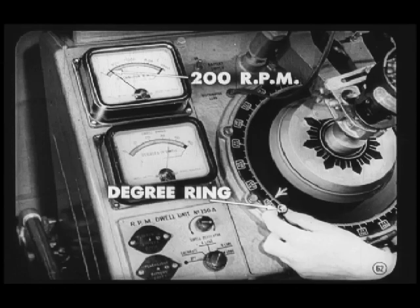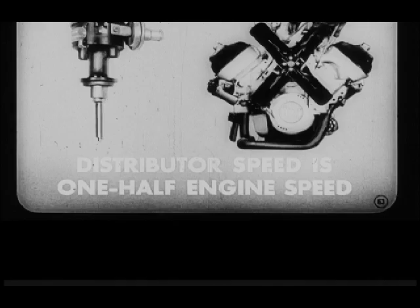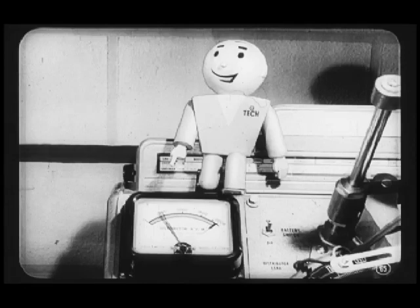Right. Now let's start with the centrifugal advance checks first. We'll run the distributor at 200 RPM and set the zero on the degree ring so it'll line up with one of the flashing arrows. And remember, fellas, that means 200 RPM distributor speed. Distributor speed is one-half engine speed. It's a good point, Tech. Now, let's increase the distributor speed till the arrow flash shows 2 1/2 degrees advance on the degree ring. Notice that the tachometer reads about 420. Anything between 350 and 500 RPM is okay.